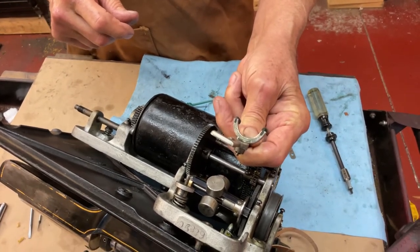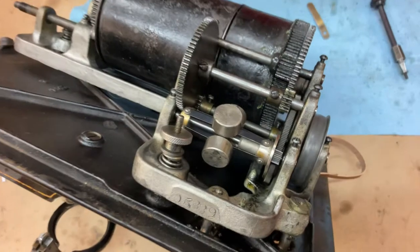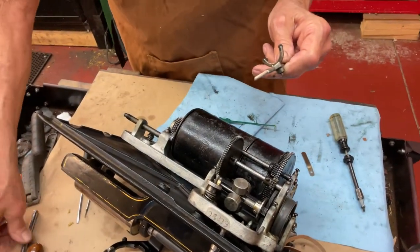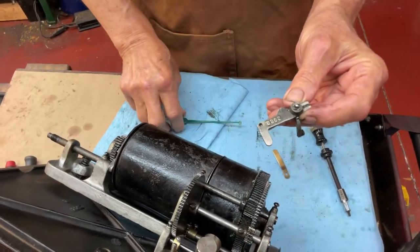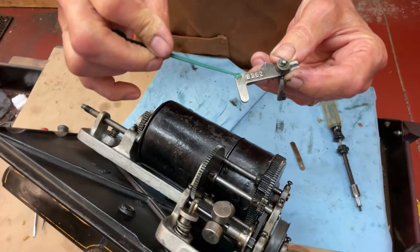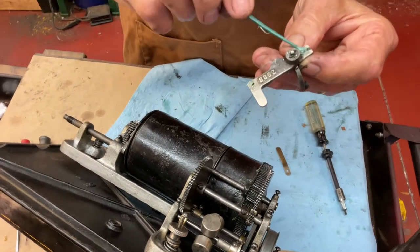It's leveled out, because if you don't bring the speed control up, this piece here is going to fall down there and you're going to have to get your little extender magnet automotive tool to get it out. In the last video I said I greased these two pieces — the reason I greased them is that it helps keep it in place. So first we're going to put a little grease there; you can use any grease you want, I just use the old lustrous green grease.